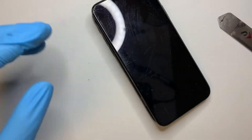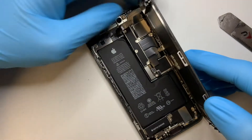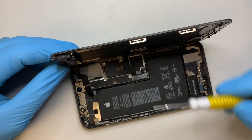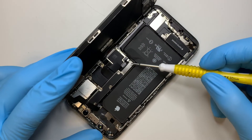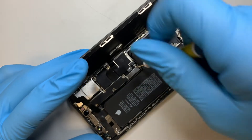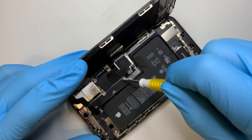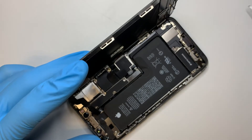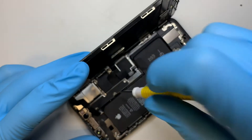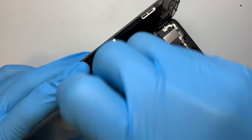The phone opens up to your right. You need a Y screwdriver — go ahead and open up one, two, three, four, five screws and remove the bracket after. The screws are not the same, so make sure you don't mix and match those screws.